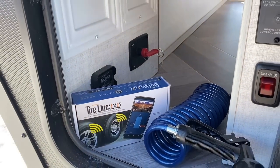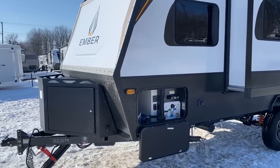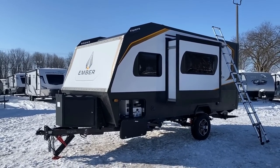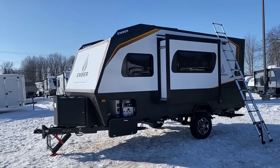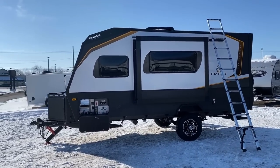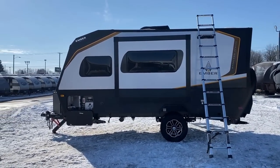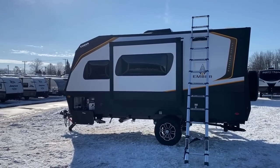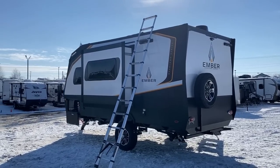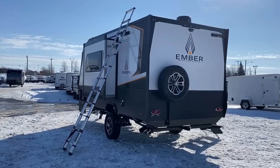Factory-included garden hose sprayer style, and a factory-included tire pressure monitoring system. A little TireLink clips right in there. When you get the LCI OneControl app on your phone, the TPMS integrates into that and can provide live in-motion updates — it will send you a notification. It doesn't just monitor tire pressure; it also monitors tire heat, which is a real concern, and will alert you if a tire is currently deflating.